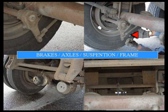What was really wrong with it, they put some new brake cans on this and didn't bother to cut off the push rod. Your brakes cannot exceed a 90-degree angle at any time. If it does, you're losing brake efficiency off of it. They need to cut that push rod off so when you apply it, it goes to approximately 90 degrees, and that's where you're getting your maximum efficiency. That's actually considered an out-of-adjusted brake.